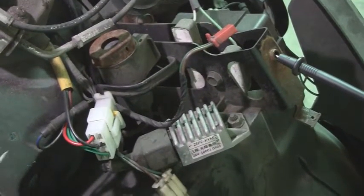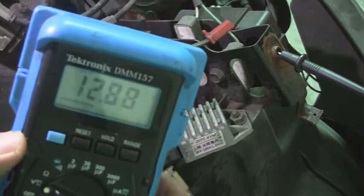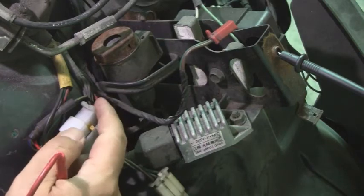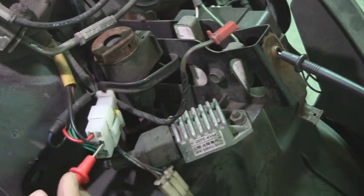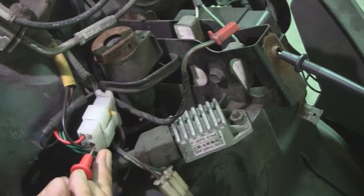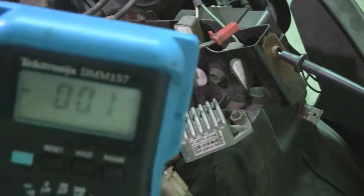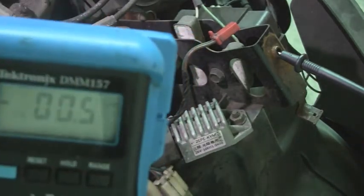So we're going to take the ignitions off. We're getting a 12-volt reading right there — 12.88. This is the hot wire that comes from the battery on this side. But we're looking for something else — something that doesn't register when the ignition is off. So we'll try this one here: zero millivolts. This one: 16. This one: 16. This is 0.1. This one: 0.7.